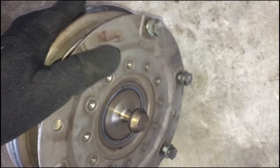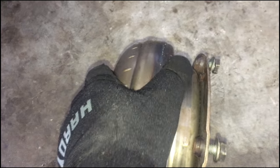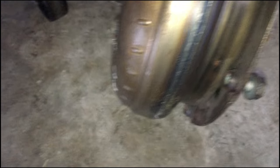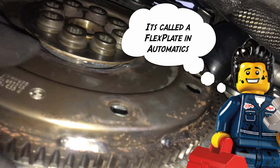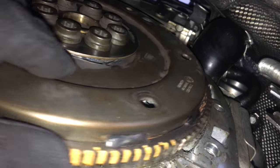So I have the torque converter out, and it's six bolts that encase the whole torque converter. It looks pretty good, but once I took it off I was like, what the heck? This is what I found — the flywheel is completely separated, like right around here. That's not supposed to be happening.